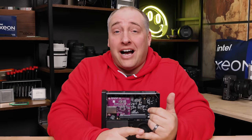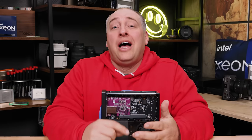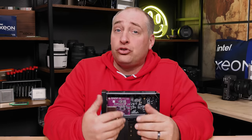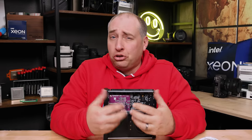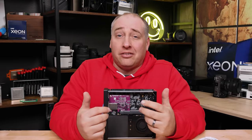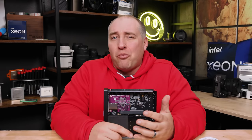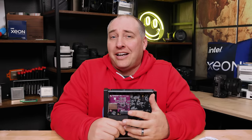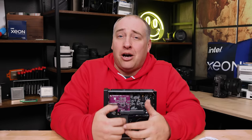We also tried some really hot PCIe SSDs and things like a Bluefield 2 DPU. There were things that worked in the slot, but they were so hot because they push so much power that I just didn't feel comfortable telling folks to put them in a system like this. My general take after playing with this for about a week and throwing tons of different cards in: if it's under 25 watts you're probably okay; under 15 watts I feel pretty comfortable. Once you start getting over 25 watts, cooling is going to become a challenge.